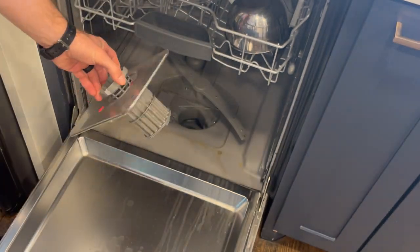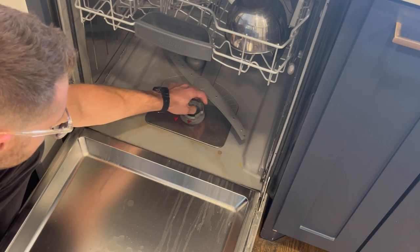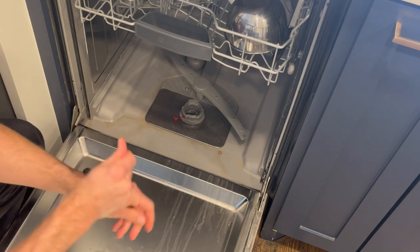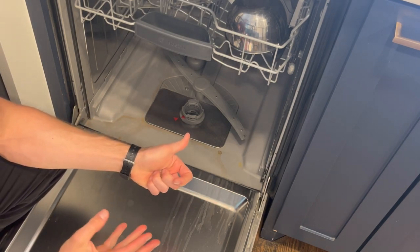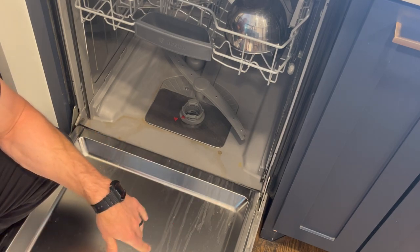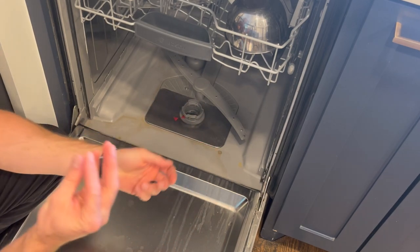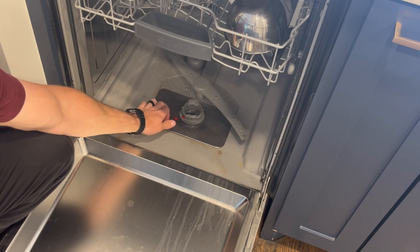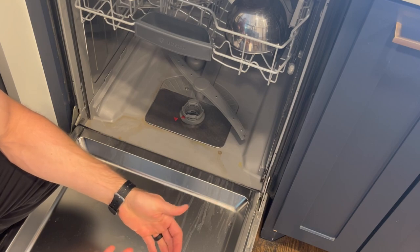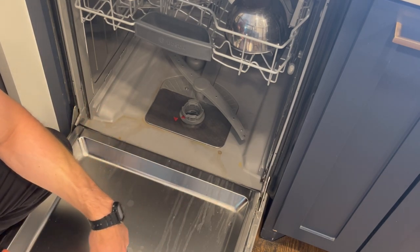About once every few months, or a few hundred washes, you come in here, remove that catch basket, clean it in the sink, and put it down at the disposal. Essentially, the reason why you can put dirty dishes in a dishwasher is because 99% of the food we eat is completely water-soluble. Hot water mixed with soap breaks it down into very fine particles that can drain through a grate. The few things that can't drain through — maybe bone, maybe a seed, something like that — will remain in the basket. You take it out, clean it, put it all back together, and run your dishwasher.